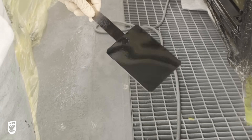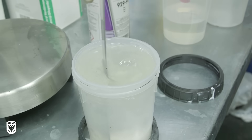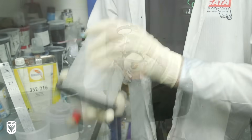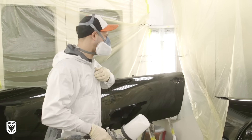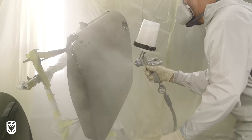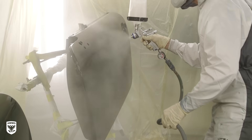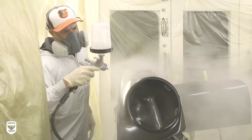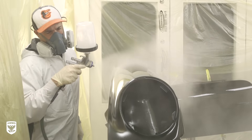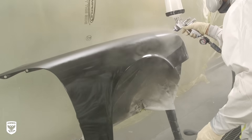The first coat of clear is relatively thin and light to avoid runs, setting the stage for the next thicker coats. When the first coat is completed, the retention panel is cleared and laid next to the car to dry at the same time and under the same conditions. After baking for another 40 minutes at 145 degrees, another mixture of clear is prepared for layer number two. Notice again his arm speed is slow and the gun is laying down thicker and thicker coats of clear — the camera here isn't doing it justice; it was so shiny I actually had to dial back the aperture.